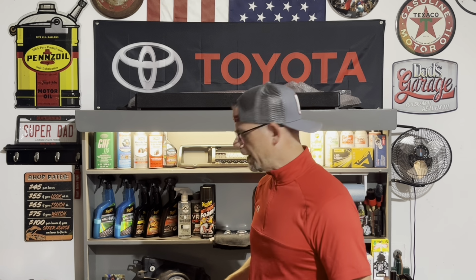So be careful when you're looking online and ordering the correct O2 sensor and ordering the parts. Sometimes, depending on where you're buying them, it might be a hassle to return them. So you just want to be safer, okay? What I would suggest is get underneath your rig, take a look around at your O2 sensors, pay close attention to the wire length, and then do the appropriate research in regards to your VIN number or what part you might be able to find.